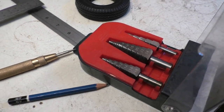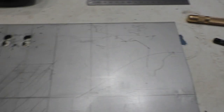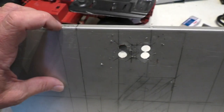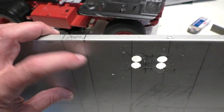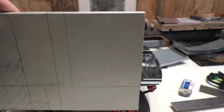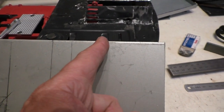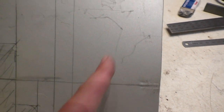These stepper drill bits are expensive, but if you're drilling holes in sheet metal they're excellent because they don't grab like a standard drill bit would with thin sheets - so worth the investment. I'll drill some holes then slice out these bits on the top where the fold is so it will roll nicely. In theory that line should line up with the floor pan. Once I've rolled it I can draw another line and put a swage bead line along here for the door jamb and cut the rest off.